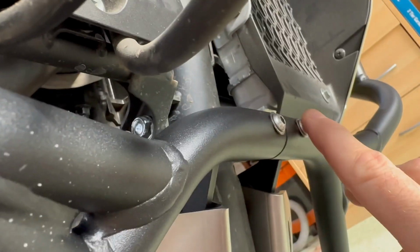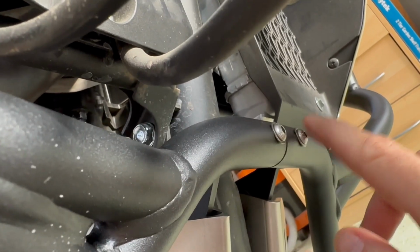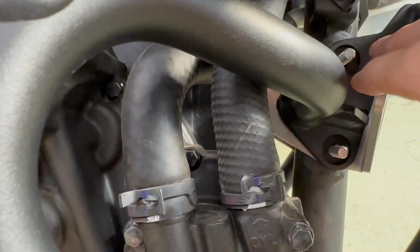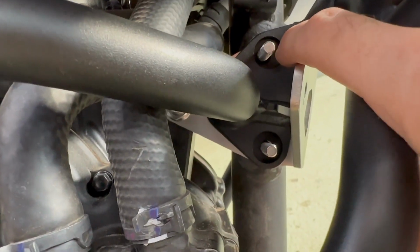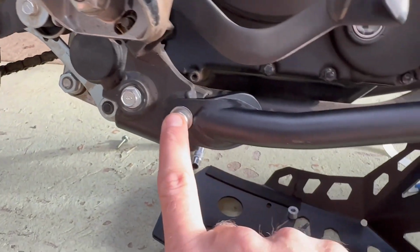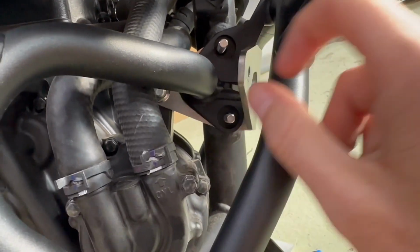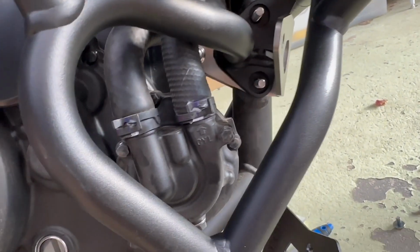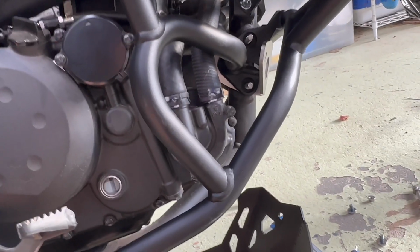Over this side now, this one here is Loctite, because that side I'll put in first. That's Loctite in. This one here is just in tight, no Loctite. We've then got the bolts coming through, big rubber grommet plate behind that. Then this one's slid on. This is cinched up here tight, not Loctite again, as I said. We'll put these bolts on, get the bushings in place, and then we can move on to start removing and re-Loctiting aspects. So it's looking good. Then we put the bash plate on last, obviously, which is good.